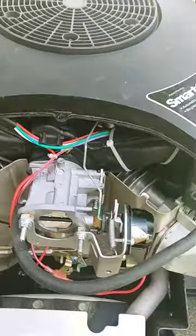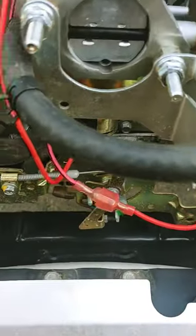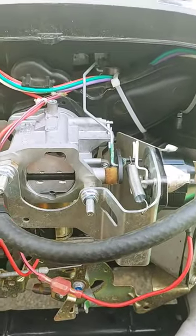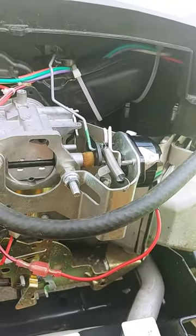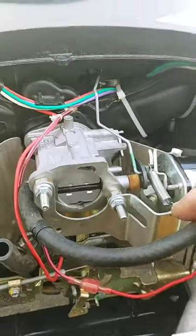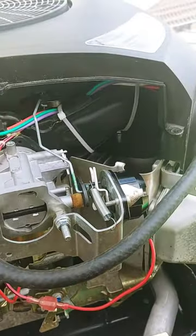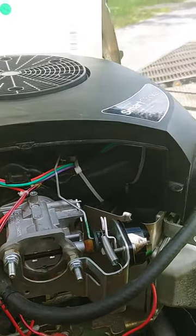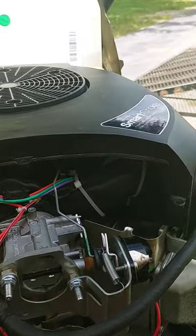You can see it closes that butterfly right up and gives tension on this spring to close it, because this thermostat is not working right. Hopefully that'll be a quick fix for anybody out there. I was going to hook up a manual choke, but it's like there's got to be a better way, so I conjured up this idea here and it seems to work. Why they couldn't just stick with a regular manual choke is beyond me.